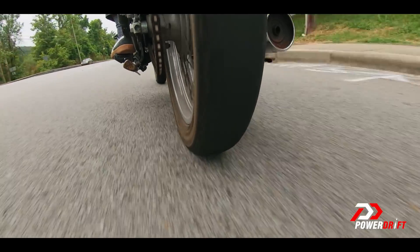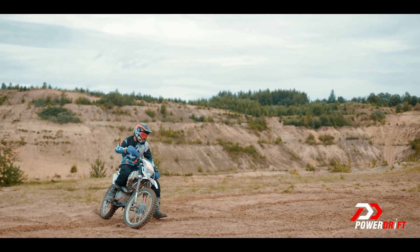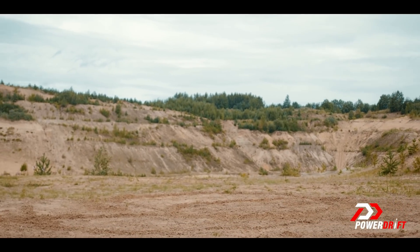In an off-road situation, the tread's job changes quite a bit. A road doesn't deform, so the tyre deforms on top of it to deliver acceleration, deceleration and turning. But an off-road surface is not stable, so the tread's job is literally to dig into that surface and propel you forward. Off-road tyres have knobs — effectively like hooks — that penetrate the surface and push the motorcycle forward, allowing you to turn and grip. These tyres always make a lot of noise, and the negative channels are larger because the job is to let the positive blocks dig in, not just evacuate water. As the tread wears and depth reduces, the hooks don't go as deep, and grip from the off-road tyre falls accordingly.